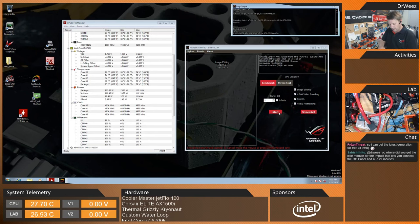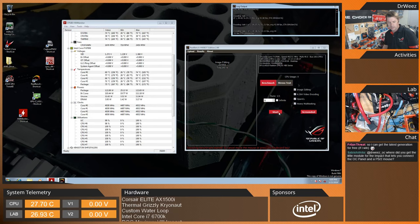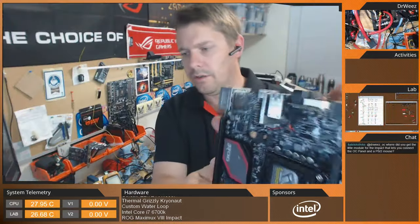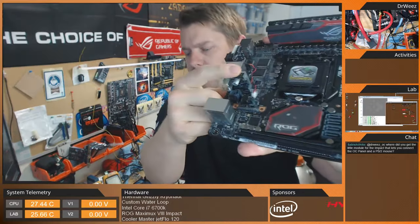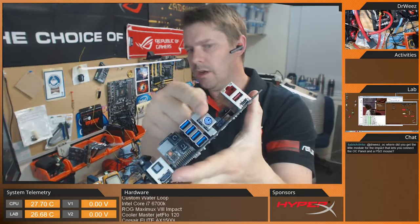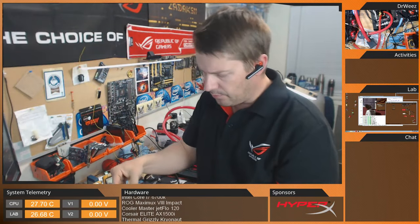So you take the wireless card out, and just transition across there. So on the Impact, you remove the wireless card and then you plug this card on, and all it really is, it's got the header for the OC panel and then the PS2 connector for the keyboard. I have seen them floating around eBay, so that's probably going to be your best bet.